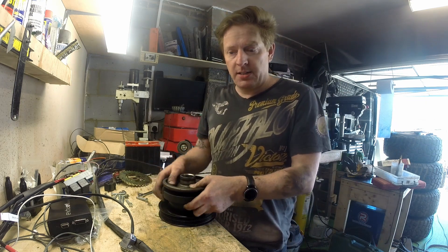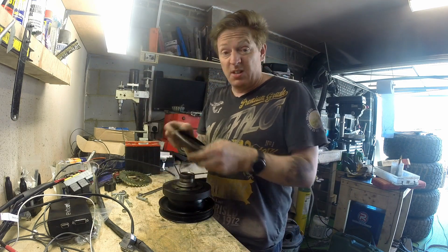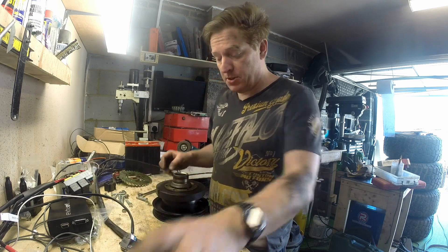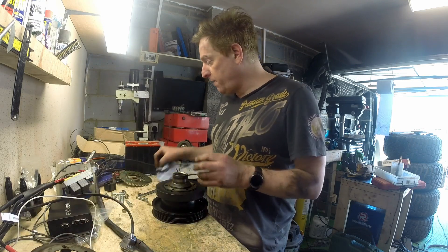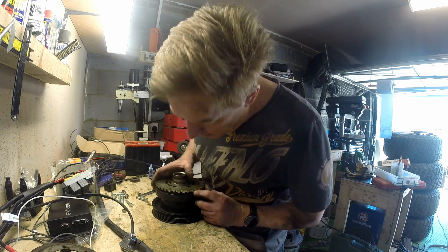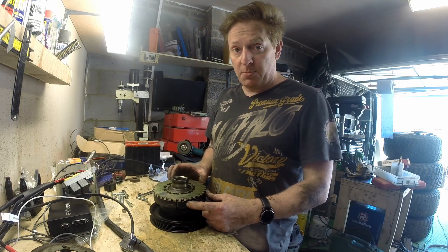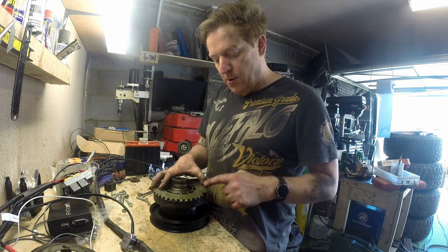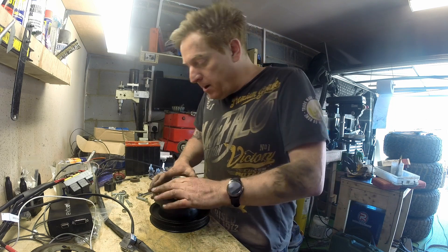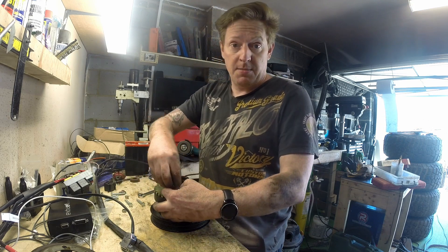So that's the sensor mounted. I've put a mark on the crank wheel where the sensor sits, and I've already taken the nuts and bolts off. We're going to put the trigger wheel onto the crank wheel. That pen mark shows where the sensor is at top dead centre, so the missing tooth needs to be one, two, three, four, five teeth ahead of top dead centre. Now we know exactly where that is, we'll clamp it on and bolt it all back up again.